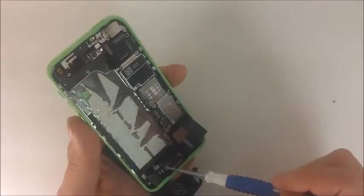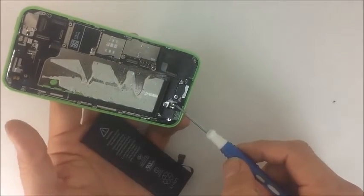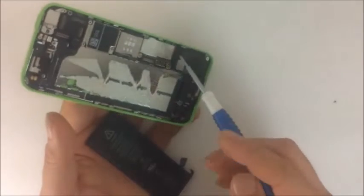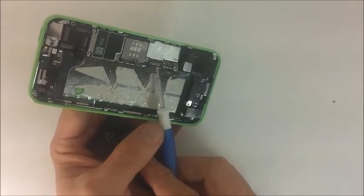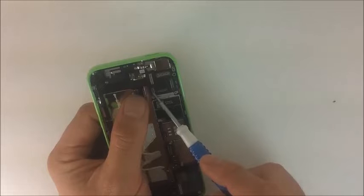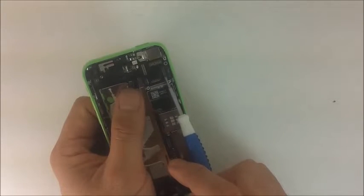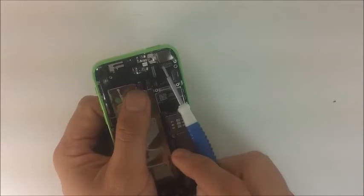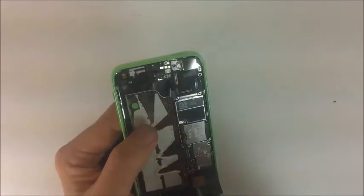Here's a brief overview of the micro components of the iPhone 5C. That's the headphone jack, that's the home button receiver prongs, that's the charging port, that's the loudspeaker, and these are some integrated chips. We have the battery receiving dock or pad, the charging port pad — both of which can be soldered and desoldered. We have the power and volume button flex receiver, the back camera, the front camera flex — which also includes the loudspeaker microphone and proximity sensor — and the digitizer flex.